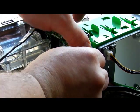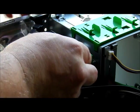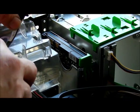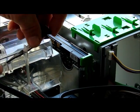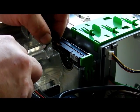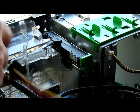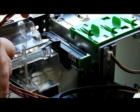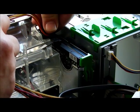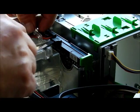Put it right back in — remember the circuit board is facing you. When you do so many computers it's hard to remember each one, but that's how I remember it. When you put the connectors back on, run them underneath the clips on the fan housing. I don't like seeing technicians slap them back on without routing them properly, so take these and run them back underneath all the fasteners.